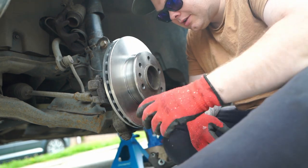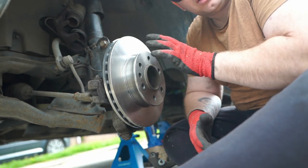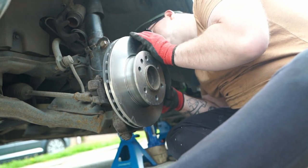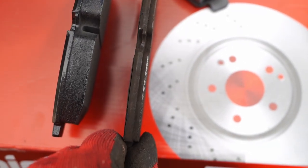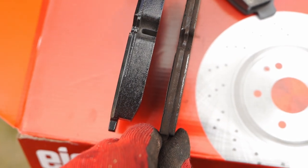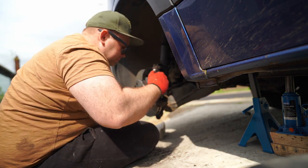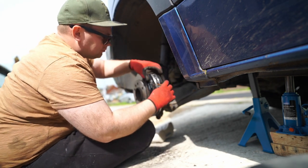That location screw doesn't have to be too tight, just nip it up. There's actually no point in it being super tight because once the wheel bolts go through they hold the disc in place. That screw is basically just there to hold the disc in place when you're removing and refitting the wheel. Here you can see the difference between the old and the new disc — it's quite a big difference. At the beginning of the video when I went through all the stuff you need, I totally omitted a G-clamp. G-clamps are super important and I only just remembered when I came to fit the caliper over the new pads.